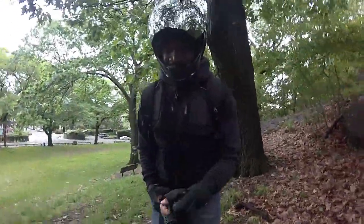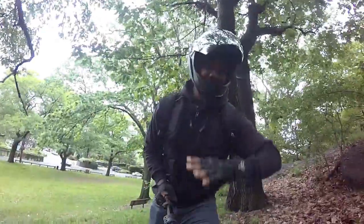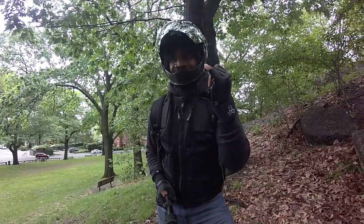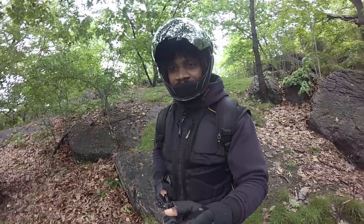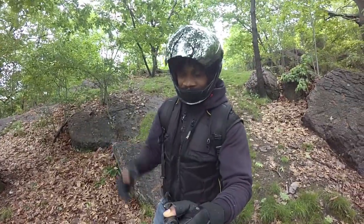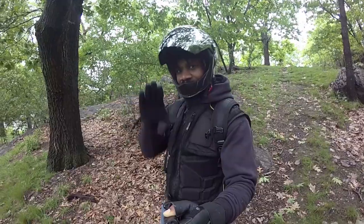That's another thing I hate about this wheel. The moment you lift the handle, this thing right here just cuts out on you. But the InMotion does that. Kingsong does that. But Gotway does not do that. With Gotway, you push the cutoff switch and it still has some power going to the wheel, so you don't automatically just cut off. Once you let go of it, it comes back.